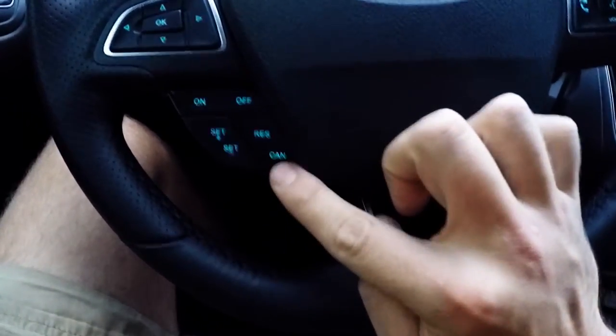So what you do is you take the cruise control cancel button, push it, and then shift plus or minus on the cruise control. That tells you which map you're in. Say you have five maps and you want to go to map 2 — the tachometer will jump up to two grand letting you know you're in map 2. Currently my map 2 is the e30 map and my map 1 is the 93 octane tune. As soon as I get parked I'll show you guys how the cruise control button lets you swap back and forth. You don't have to go in manually — you can do it on the fly while driving. Like, hey, let's go into economy mode for a road trip, or hey, pull up beside somebody and throw it in the hot tune, then put it back in 93 when you're done.